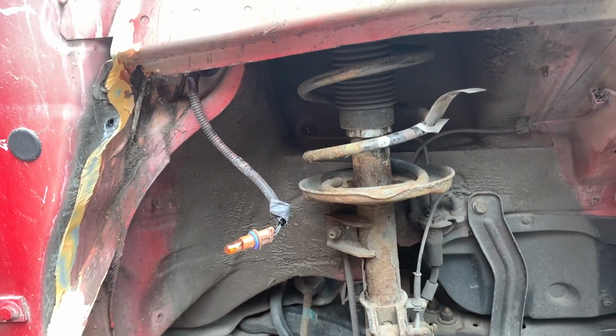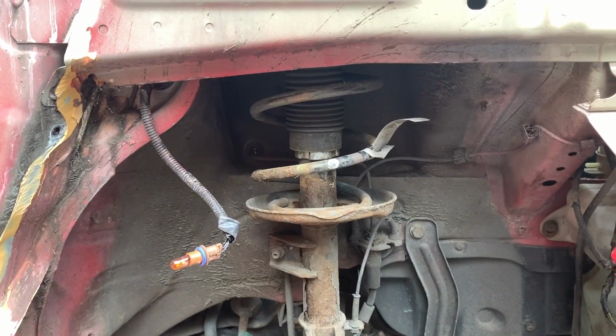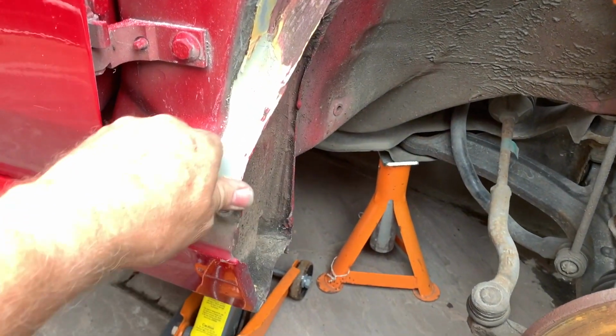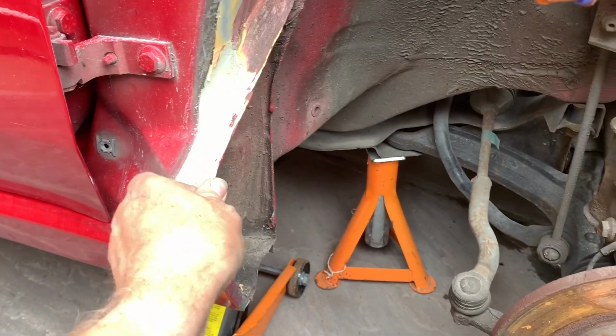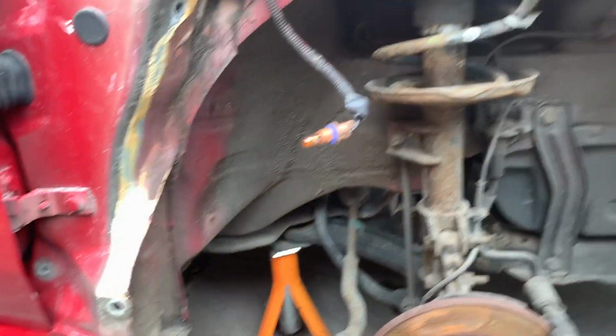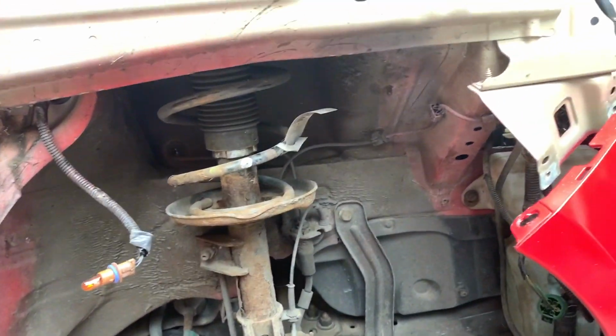Once you get the actual wing on, it's obviously easy to see which one goes where. They're more difficult to get off, because they've always got the seam sealant around them, and you can't get a spanner on there, so you have to cut the seam sealant away. But we've gone through that on the other video, which, just as a reminder, I'll put the link below.